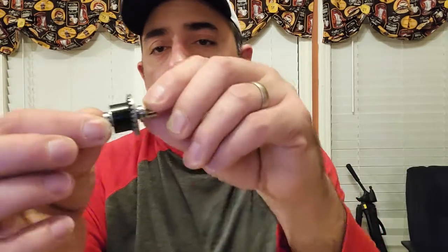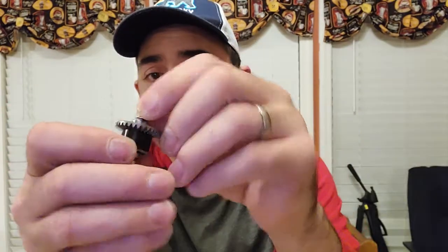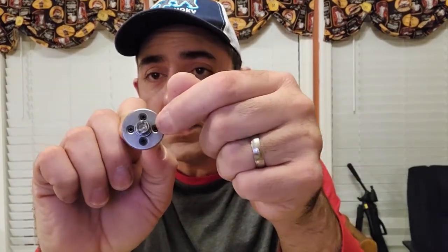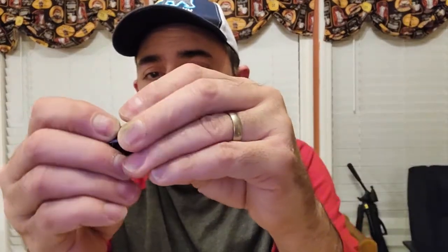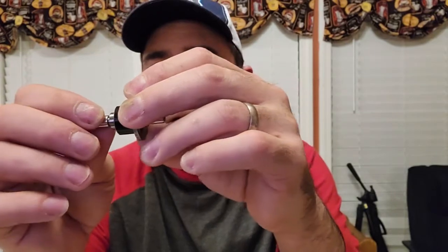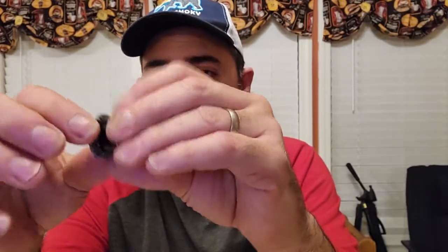And these are serviced, but I decided to upgrade, feel me out here, to the, and I keep dropping screws here. Where'd it go? Okay, no, it's in there. Metal case, differential case. The plastic case, I've seen a lot of people when they service them and they start screwing in, the screws are right here, they tend to have to play with it a little bit because the play in the differential gets a little stuck. I guess because the plastic parts get binded. It's the only thing that I can actually think of. But that's the thing. I decided to go with the metal one.